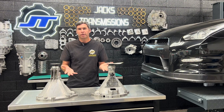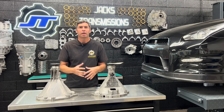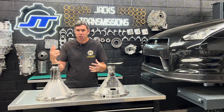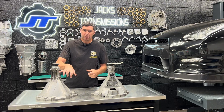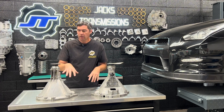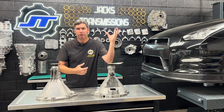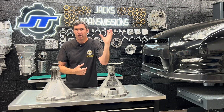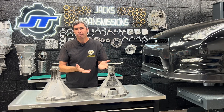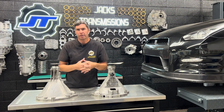There are some other failures with these that will create noises like a hissing sound coming from the bell housing area — it sounds like you have a huge vacuum leak. This DBA bell housing here had that issue. It was fine, it wasn't loose or anything, but it was making a noise like 'shhhh' as the car was running. That had to do with distortion in the casing — it was putting unnecessary stress on the bearing and the bearing was just whirring away, eating itself. But again, the best way to check it is to get under the car, grab onto that carbon prop shaft, and try moving it around. If it doesn't move up and down or side to side, you're fine. If you feel any kind of movement there at all, there's a problem. You definitely want to fix it because it could cause some pretty serious damage if any of these let go due to a bearing failure.